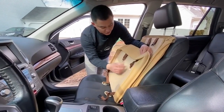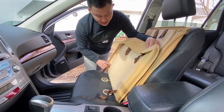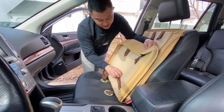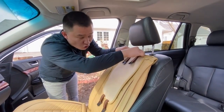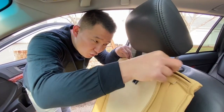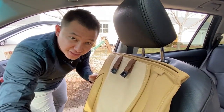Once you apply the metal hooks and the round clips at the middle, this is what it looks like. Then you want to make sure that you disconnect the apron band. Before you tuck in the front seat cover, make sure you have the zipper open all the way so it does not break the zipper while you tuck in the front seat cover.